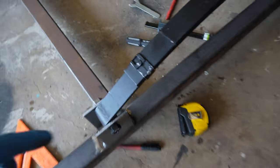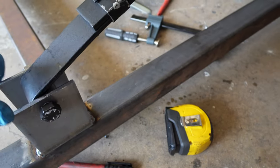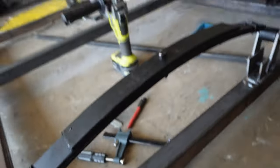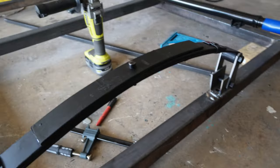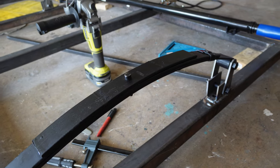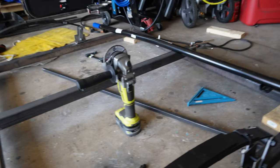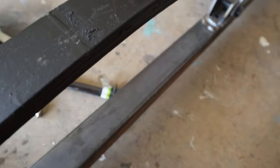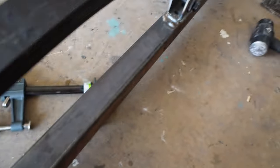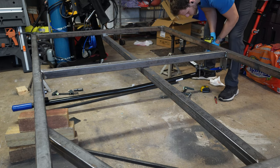We have our leaf springs mounted. These bolts are not all the way in — I'm going to leave them for now and work on them later because I want to weld more before I torque more down. I welded this side, but I want to flip the trailer over before welding the rest, because gravity will be better that way. So we're going to take our axle, put it on these studs, and then take our U-bolts and clamp them down to it — they come across into a plate we have, and they'll go right there.